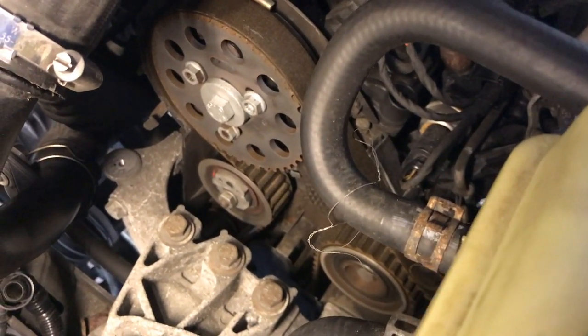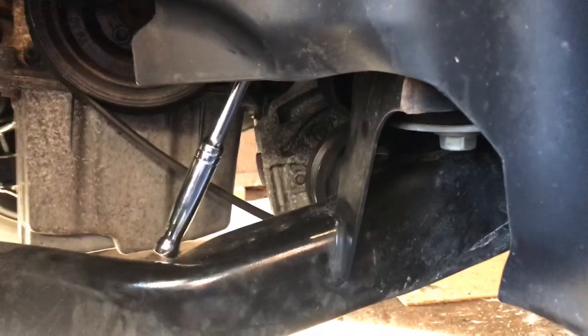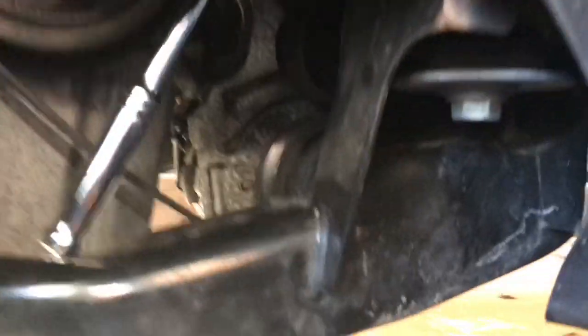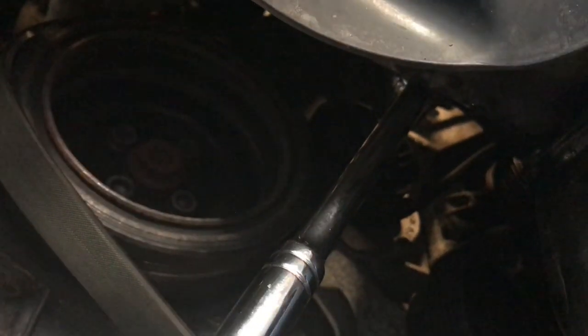We've still got the auxiliary belt on the alternator. Now underneath, I'm going to take the auxiliary belt off. It's quite simple — get your spanner up there, there's a tensioning point up there, it's a 16mm socket. Put that on there and turn it clockwise and you release the tension. I've done that and locked it so I can take the auxiliary belt off now. Remember to draw on a bit of paper the flow of the belt so that when you put it back it's doing the same thing.